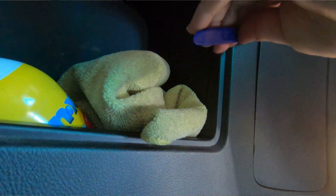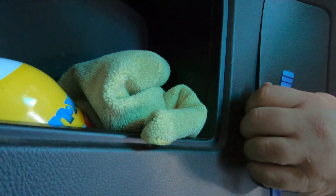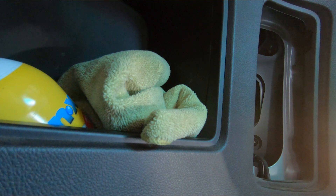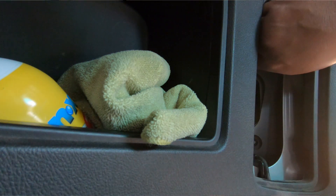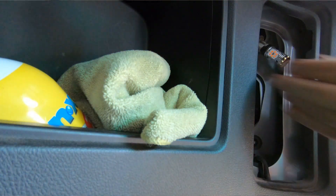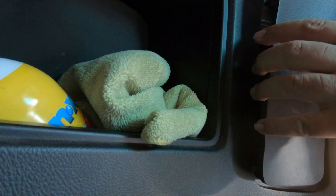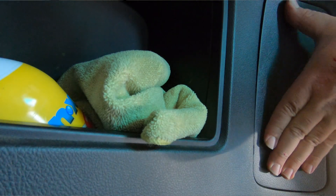The process is pretty easy. For the rears, you just pop off the panel that blocks the taillight. Simple pry tool on the front — just pop it out and the back will let loose. Set it aside and then it's the very top bulb. Twist it out, swap the bulb, and twist the new one back in. With the new bulb, which is quite a bit bigger, you're going to have to finagle it a little more. You shouldn't have to force anything, so be careful not to break anything — just find the right angle. Alternatively, it is easy to remove the whole taillight if you want. But I wanted to show it can be done with the taillight in. Pop the bulb in and pop the panel back in and you're good to go.